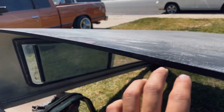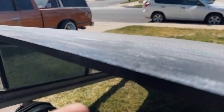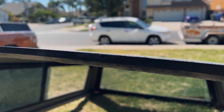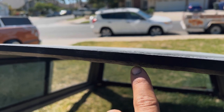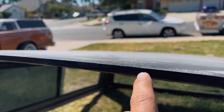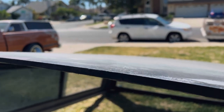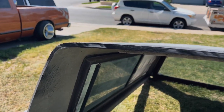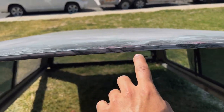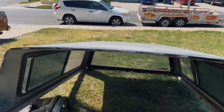We're going to do all of this — you can see there's a couple of low spots, it's hard to see them. But when there is the black paint behind it and you see all the white, then we'll be able to know that there is a low spot there. Like right here there's what looks to be a little nick — right here you can see that the angle grinder kind of dug into it a little, so that's a low spot. Obviously if I wasn't looking at it up close like this I wouldn't see that, so with the paint we'll be able to identify the low spots and the high spots. You can see where the low spots are — over here there are high spots, all these are high spots, and you can see all the low spots in there. That's kind of the whole point of the paint right now.